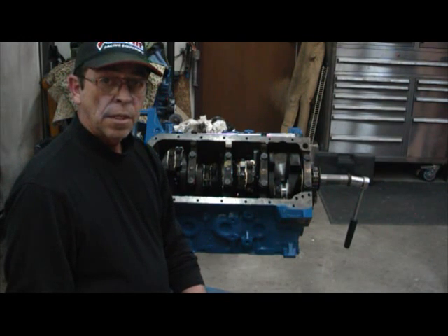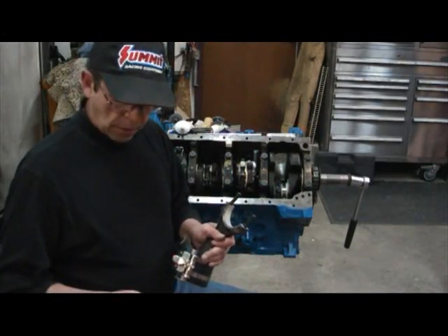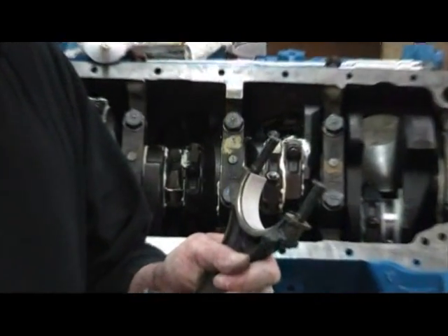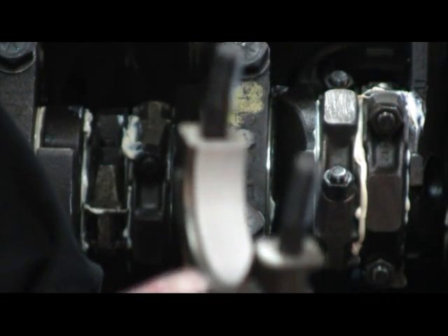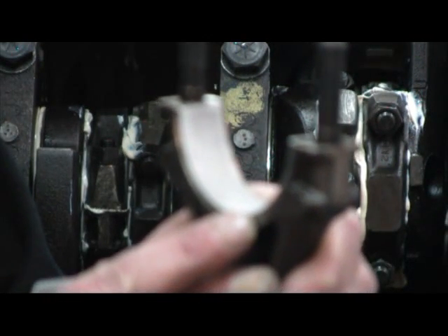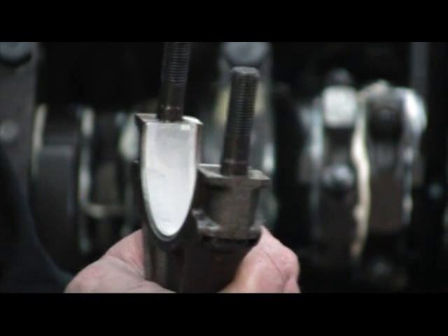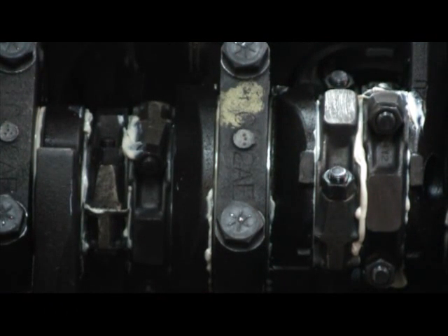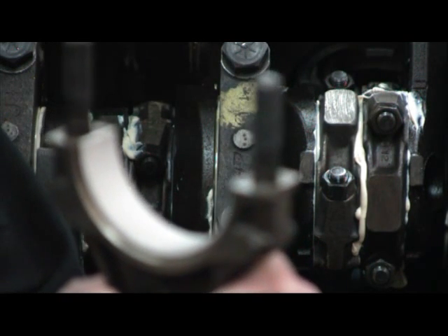One of the things I wanted to show you here is the placement of the piston so you can tell which way they go into the hole. Let me grab one of the pistons. Let me see if I can zoom in on this a little bit. With the bearing in there, you can see one side has a bigger gap in it — this side has a bigger gap than the other side, and the other side is flush or close to it. So we know the crankshaft has a radius on the journal, and we're going to put the piston in there with the wider gap towards that radius. That way we know we've got the clearance.